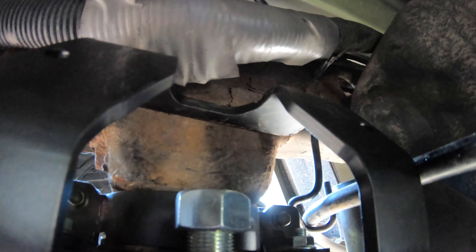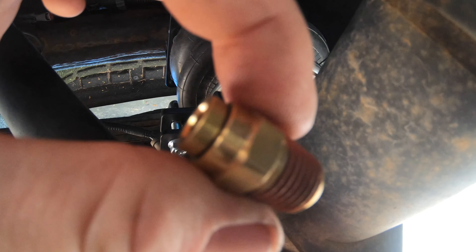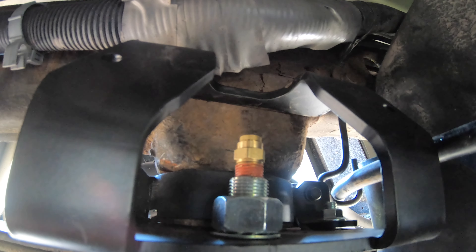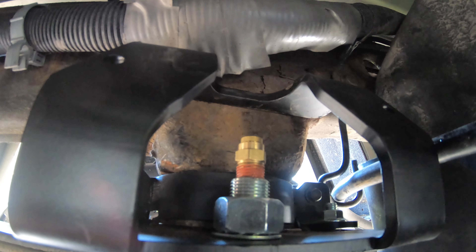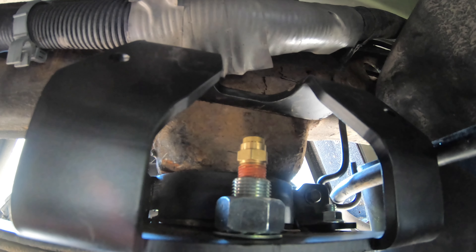You're looking at the top of the spring, and that's a big nut that has to go on there — you can see I've already got it started. I don't think I can get the camera in here anywhere where you can see; there's really nothing to attach to. But right in the middle of that I have to put this air fitting, and that's where the quick connect for the hosing will go — that's where air is supplied to the bag. I've got it partially threaded in there. I'm going to tighten it but not real tight — just down to where you see that red RTV to make sure there are no leaks. It's probably better to go a little less tight and then if we have an air leak we can give it a couple extra turns.